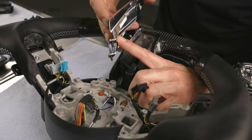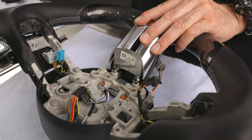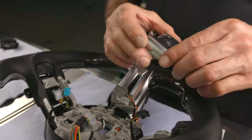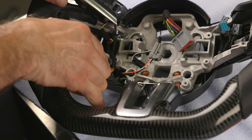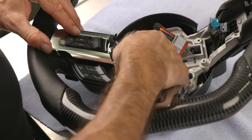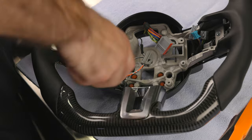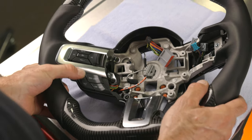Next up let's mount the V-shaped lower wing bezel. Make sure to tuck the wires along the channel so the bezel mounts flush — it should snap into place. Finish up by tightening the two screws to 44 inch pounds. We'll install the left hand controls next. Start by carefully connecting both upper and lower controls, mounting the lower control first and tightening the upper screw first. Then mount the upper control which shares a screw. Make sure to snap the rear shell with the upper control in place, then attach the remaining screws using the same screws that you removed earlier so the control assembly is attached correctly.